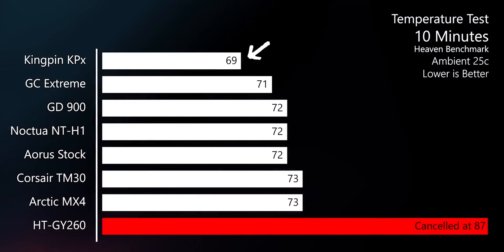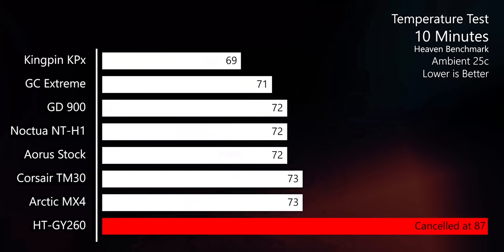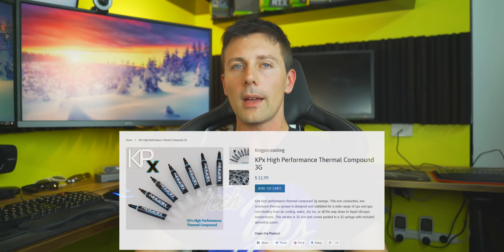which turned out to be the best thermal paste around because I saw in the previous overclocking competition I went to, everybody was using that Kingpin Cooling stuff. And yeah, it ended up being like a couple of degrees better. And now the thing with that thermal paste is, yeah, if you're overclocking and you're trying to get the absolute best for a daily overclock out of your CPU, whatever it is, a 3900X or a 3700X or a 9900K, for example, then some thermal paste like that could make the difference, just that little bit. So it is worth it if it's worth it.